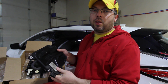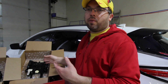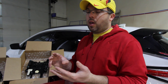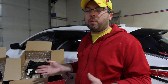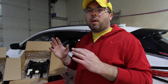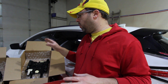Same procedure — we're going to unlock it, basically remove the personalization, the activation, the VIN, and the keys to make it like a new part so you can use a used component. Now either of these options — replacing the ISM or a VGS conductor plate — you will have to recode it back to the car, so special tooling is required. The most common tool you'll find in shops will probably be the Autel, especially in a foreign shop. I rely on the Autel as my primary go-to tool for almost everything, and with the Autel you can recode these back to your car.